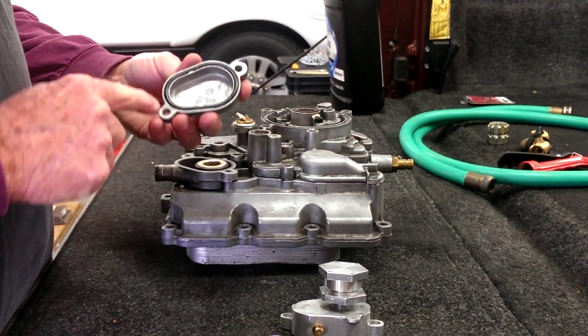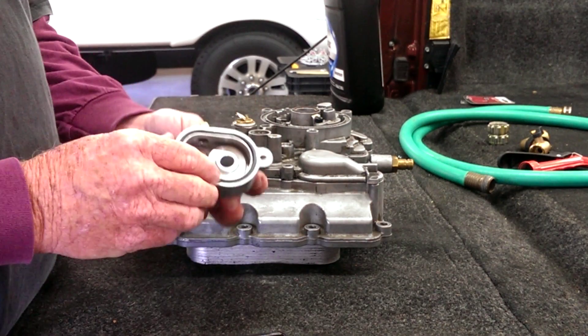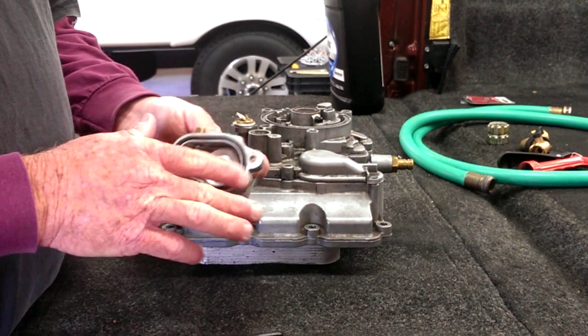I think it's 85 inch pounds. Take the cap off — it should have the gasket installed — and just put this away in your toolbox. Again, the new oil cooler back flush valve: install the O-ring gasket and install some coolant on it.